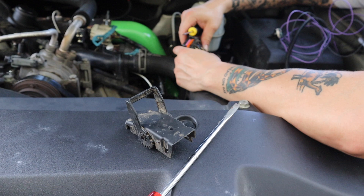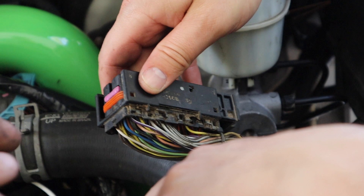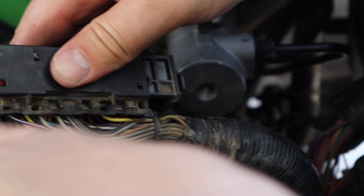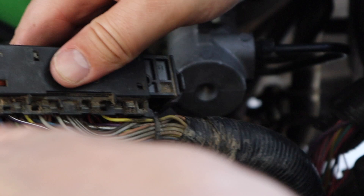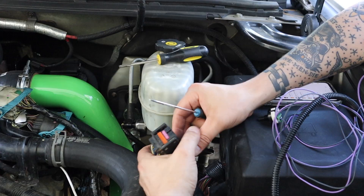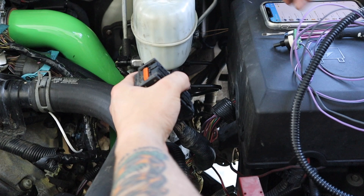Take a little flathead screwdriver and pry this top handle piece off — that's going to allow you to get to the back side of all the wiring. Once you locate where your pins are going to be, remove this pink tab, put your pins in, put the pink tab back in, and that's what holds all your wires to the actual connector. There are four clips on here to get that top cover off. If the front clips are broken, you can just pull them right out. Corey's going to remove that pink tab, which allows all the wires to be loose so we can insert the pins into the correct slots. Then once you have your pins in place, put the pink tab back in to securely lock all the pins.